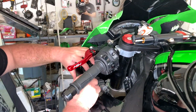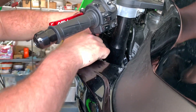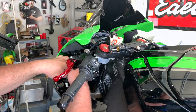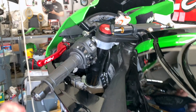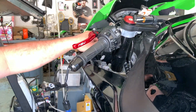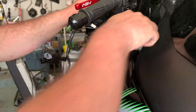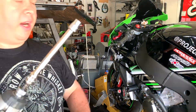We unclip this to free up the harness. Then we unplug the headlight — it's a gray plug — and right here you unplug the servo, which is a blue plug. You want all that to be free. There's another vacuum sensor that's impossible to take off without taking time, so what you do is cut it to free it up, and then grab your 10 millimeter right here.